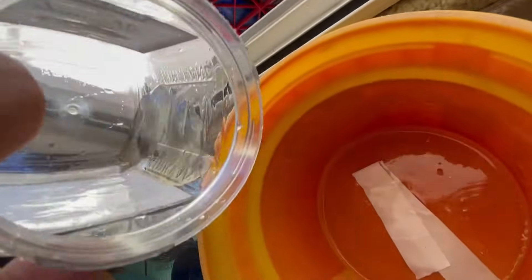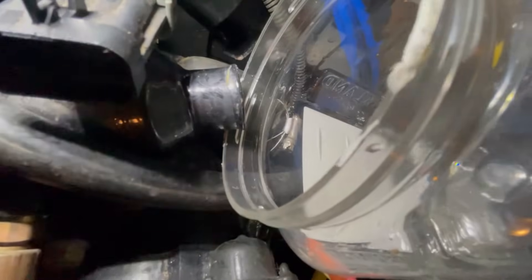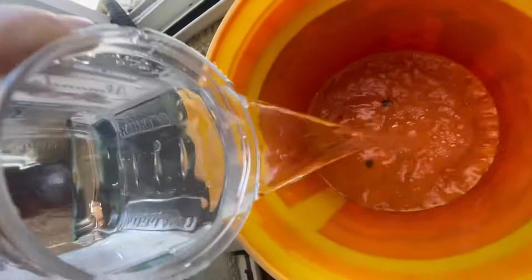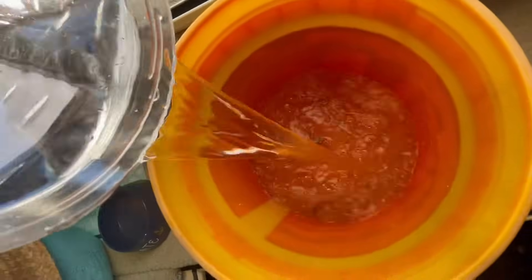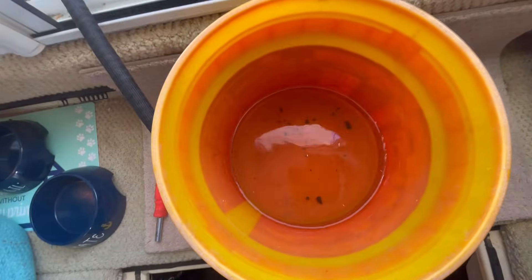I had those large chunks pulled out with my finger, but then you can see all these small pieces that came out that were stuck in the tube. I gave it another good flush and had a few more pieces come out. All those black pieces are what was in there. I flushed it again and nothing else came out to speak of, so I think we're good there. We're going to hook those hoses back up and move further down the system.